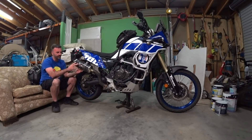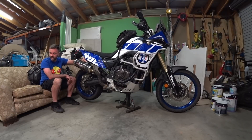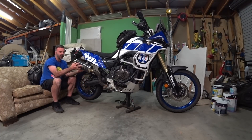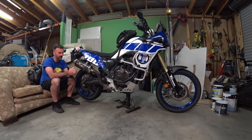Let's talk about this exhaust. I like this type — it's up out of the way. I've much shortened the exhaust pipe hanger; you've seen people publish where they've bent those and the exhaust moves in and clashes with the swing arm. So I've cut mine off and welded a plate and a little bracket in here, done by my friend Peter who makes exhausts.